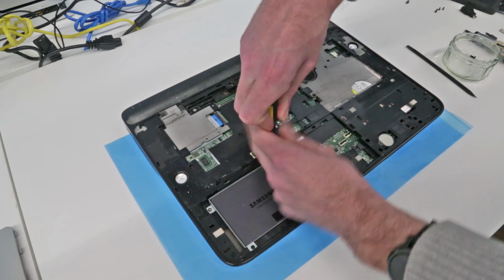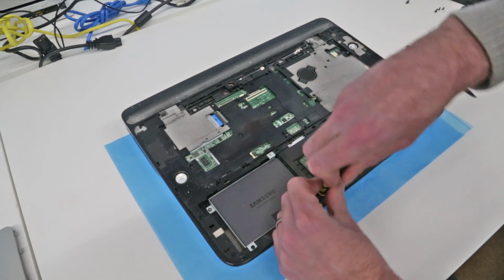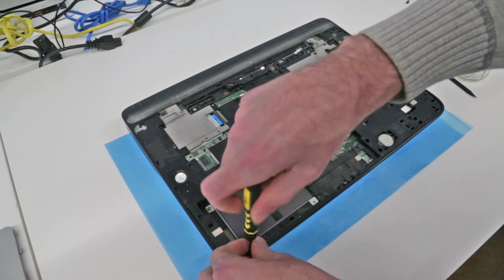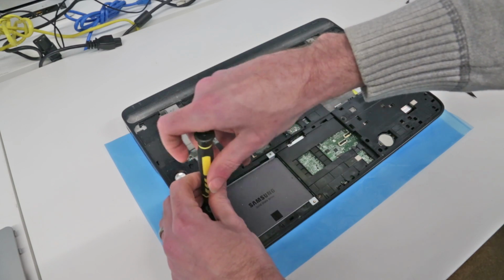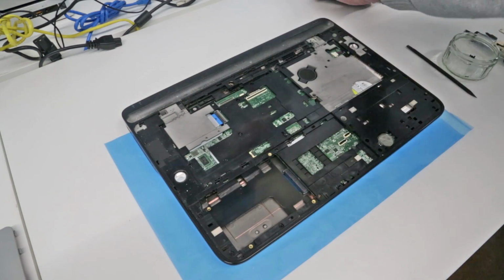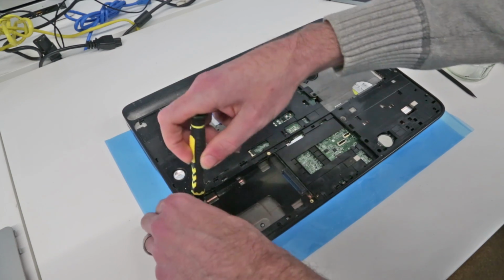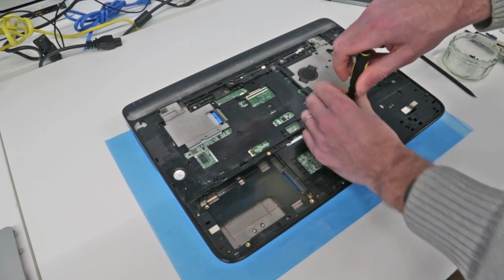In the process, we might as well just, over here, first remove the hard drive, because that's obviously going to have to come out as well. Slide the hard drive out and left, and then return to working around the screws in the base. Obviously, while this is all off, we're going to give a clean in there because that is quite the dust trap on it. And it'll just improve the look of the machine, giving that a bit of a wipe out.